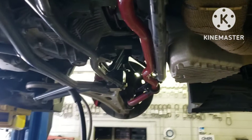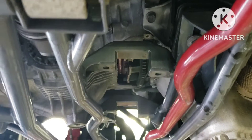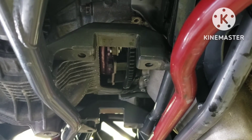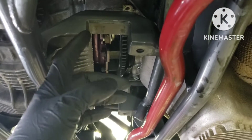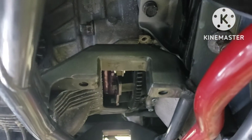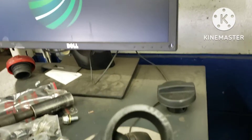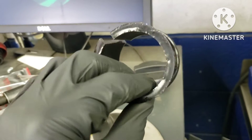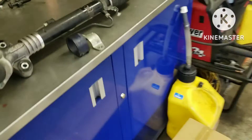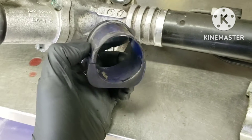So this will apply to all you GR/GV chassis guys out there. My biggest gripe with the TSS fab subframe is that the rack mounts are square, where on the OEM subframe the passenger side rack mount is semi-circle to half circle. And if you look at the OEM bushing on the passenger side it's a round bushing — so how's that supposed to fit into a square hole? What I ended up doing originally was I got a rack bushing from like a 02 to 05 WRX.